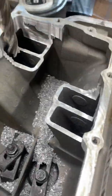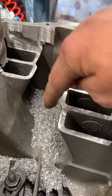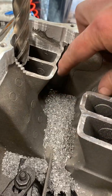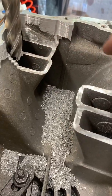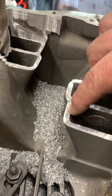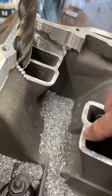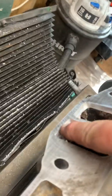What I'm using with the BRPs — I take my runners down to a flat boss because all of this here is going to be covered with the BRP plates, tack welded in each spot here to hold the plate in place. So it gets rid of all this volume inside. Basically I take from this inside edge right here to the inside edge of the runner, and I have 11 inches. And on the outside here, I'm 15 and 3 quarters to 15 and 3 quarters.